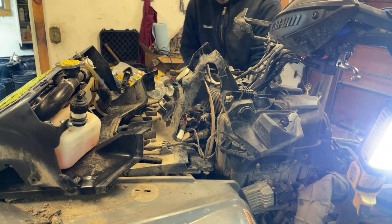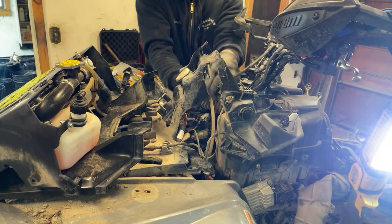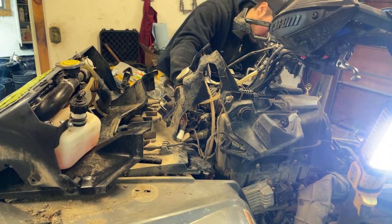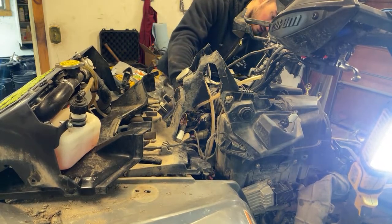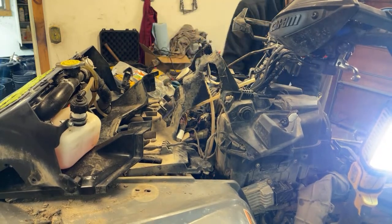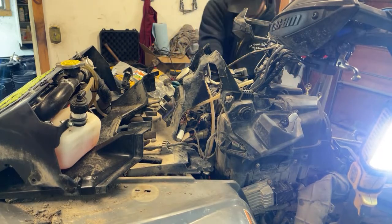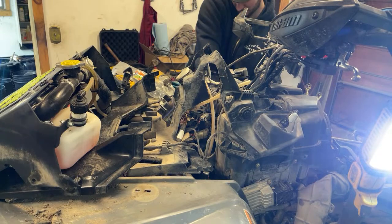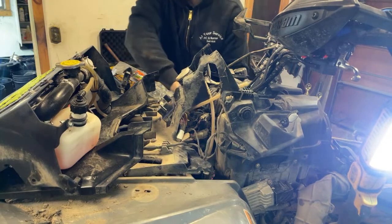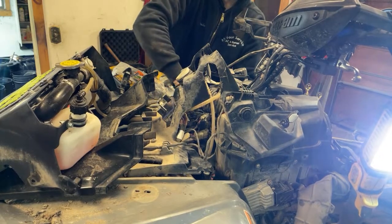All right, I think I'm gonna move over to this side now. Actually, maybe pull my snorkel or my vent tubes up rather. Get them all back up top. I pulled them out of the way before. Let's see here. Put the harness up in here now. And I have to reconnect the actual PCV oil vent, technically, whatever you want to call it. Those things, I gotta get them going here again. Or just that guy goes to the airbox.